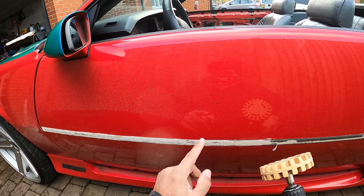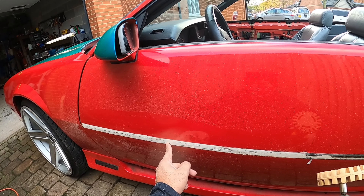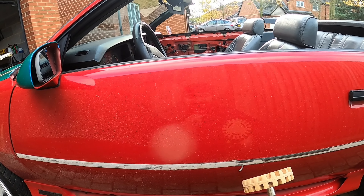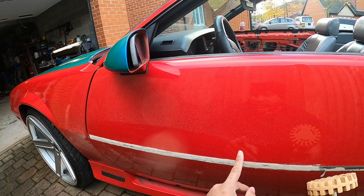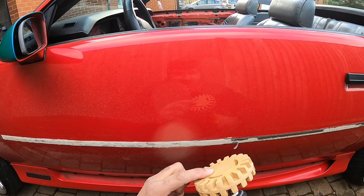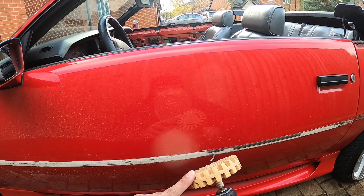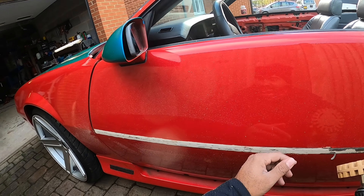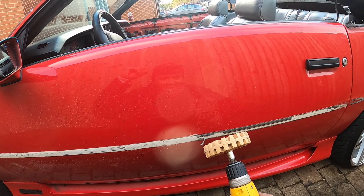You guys can see how easy that came off. This is not burning the paint down to white — that white was already there; they sprayed over the entire trim panel itself. Safety caution: if you hold this tool to the paint too long, you can definitely burn through the paint. I'll leave the tool I'm using in the description below so you guys know what type of tool to use to get this adhesive off. This also works great on wheels for removing old weights with sticky residue — it's a pretty good tool to have.